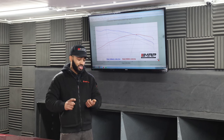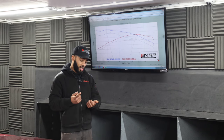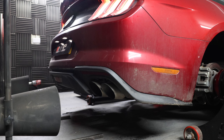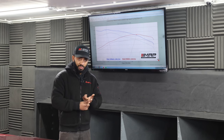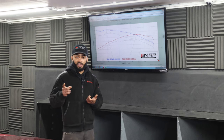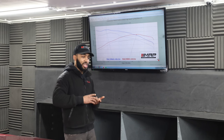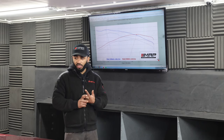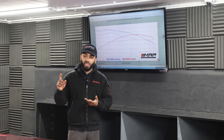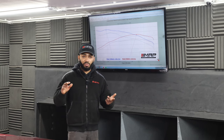We've added a few extras to the software. Now we've got sport mode burbles so you can have a nice burble in sport mode. We've also got neutral rev limit disable — stock software is limited to 3,000 rpm when in neutral or park, so that's been removed. And we've got cold start solutions, so people with extremely loud cars can actually disable the cold start and not annoy all their neighbors.